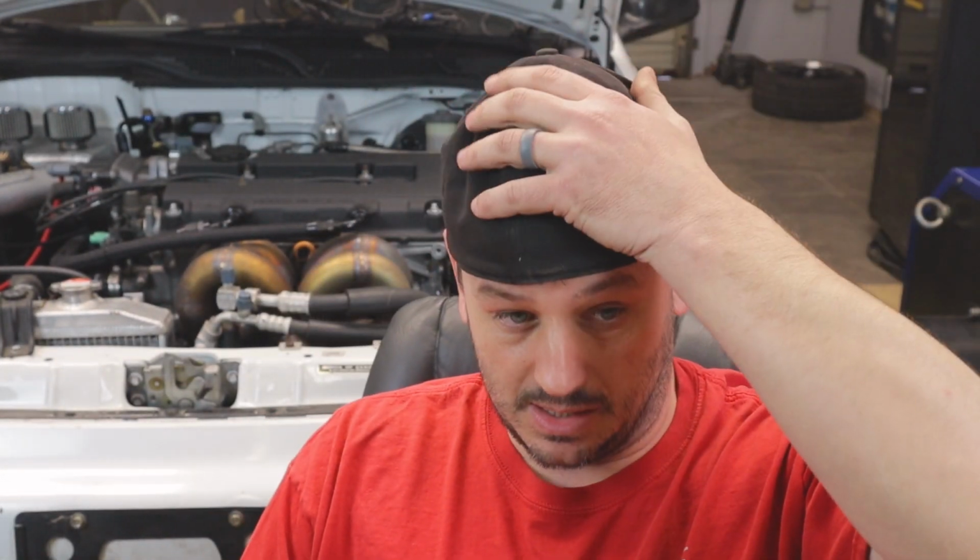I didn't have a great experience with the Mustang dyno, so I just kind of leave that alone. The Dynojet literally had a green button and a red button, green for go, red for stop, and that's about all that it did. And my Dynopack did a little bit of stuff. It did have some pretty solid steady state control, the ability to control the rate of acceleration of the runs. So it worked pretty well. I like that dyno a lot.